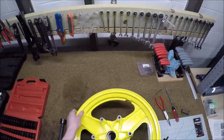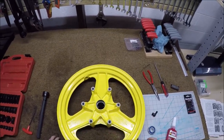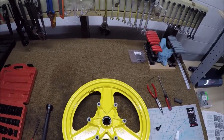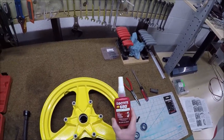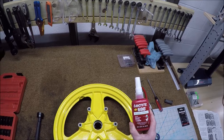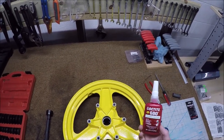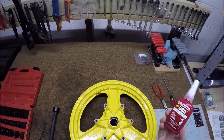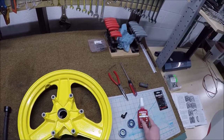I called a coworker, started panicking, went through a bunch of ideas. He called one of his racing buddies who races boats, and he said there is something for you — this exists, you're not the first person with this problem. He recommended green Loctite. Now there are like three different types of green Loctite. I used some and took a guess that this is the one I want. This one operates up to 180°C — there's no way these bearings are going to reach 180°C without something else breaking.